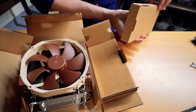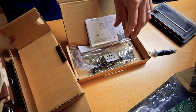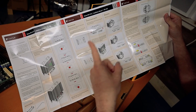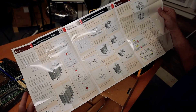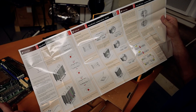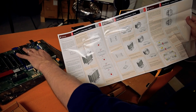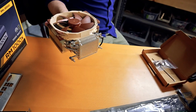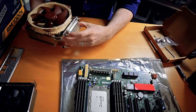Let's take a look at what's inside the smaller box here. Since this is a specialty socket type, I'd definitely recommend taking some time to read the manufacturer's recommendations. Not having to go back and mess with it frequently will prevent any injury to your socket — EPYC sockets are known for being finicky about how tight they need to be before you risk damaging the CPU. Let's take a look at the clearances once we install this.